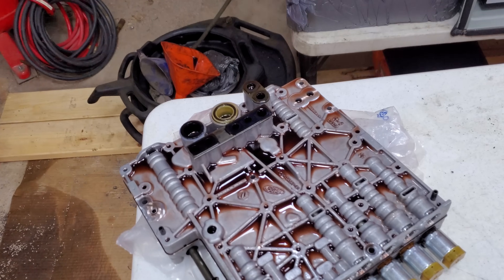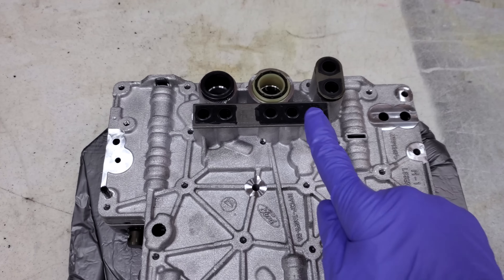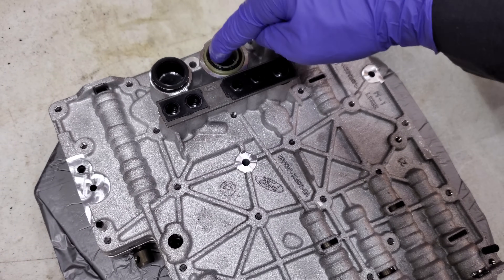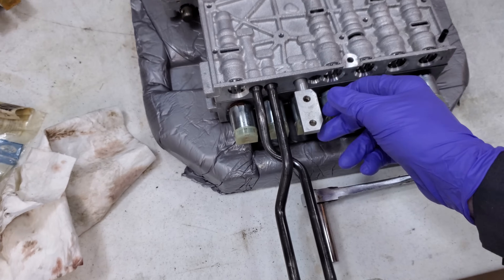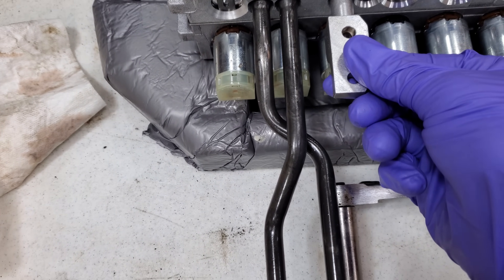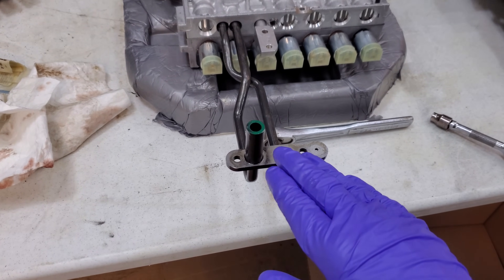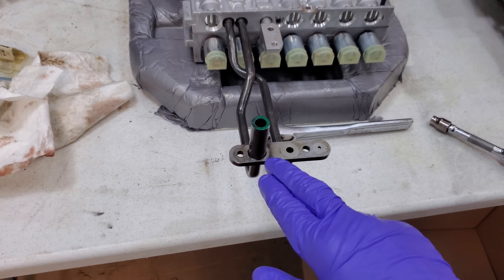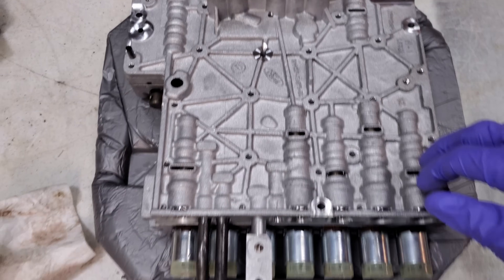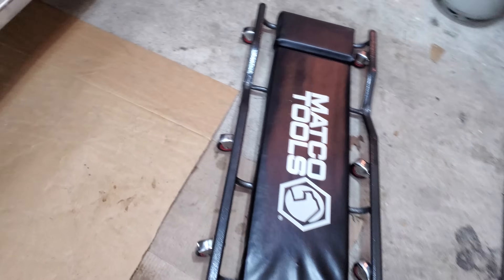Here's the old valve body looking nasty. You can see the gaskets on there — they actually come on the new valve body, but they did not specify that in the parts catalog. The only one it did not come with was this one here, which I just pressed in. I did have to transfer these over and they had new O-rings. I'm going to put in the description all the parts and rubber O-rings you're going to need to complete this job. I've already installed one squishy O-ring here, and one is stuck up in the trans — I've installed the new one. They're different heights and everything. This is going to be ready to put back in.